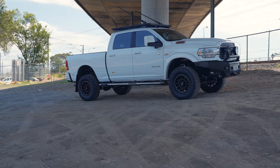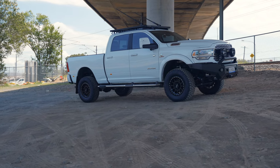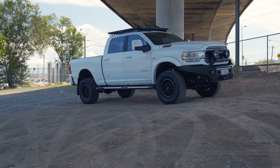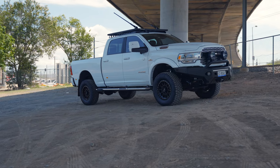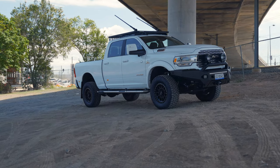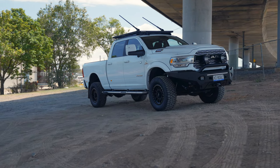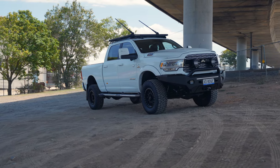This thing looks great and it's going to perform even better once that canopy goes on the back. If you've got a Ram 3500 on order, it's definitely the best platform for weight-carrying capabilities of any of the HD trucks - you've got over a 3,200 kilo rear axle load rating. If you're chasing a canopy combo, boat loader, rooftop tent, and a decent fan, definitely check out your axle load ratings on the vehicle you're looking for. This is the number one option here at Big Dog.